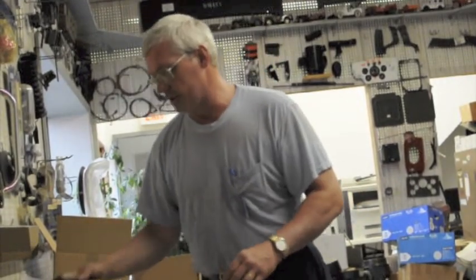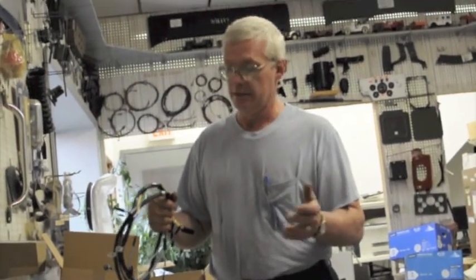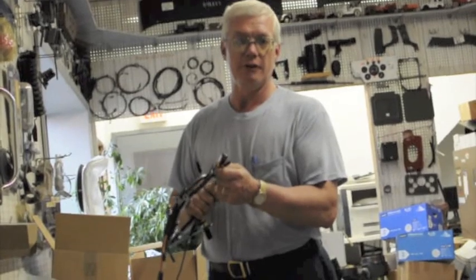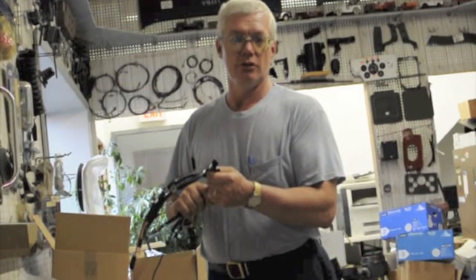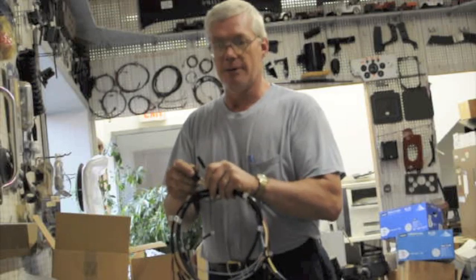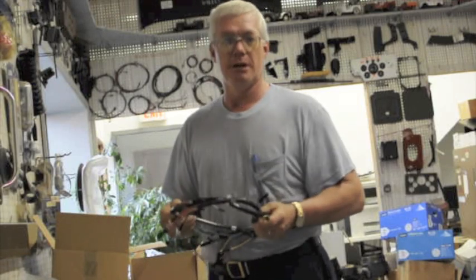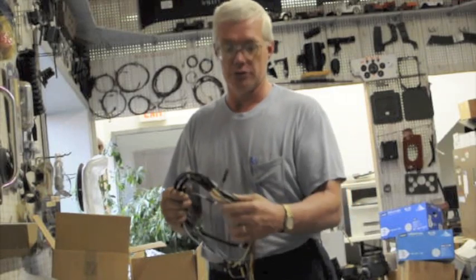These earlier harnesses where the Jeep was 6 volts, if you want to change it to 12 volts you can, because 6 volt wiring is heavier than 12 volt wiring. So it'll easily take the amperage, because 6 volt had a lot more draw on amperage than 12 volt did. So that's not a problem with changing a 6 volt to 12 volt at all.